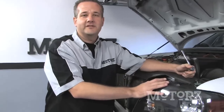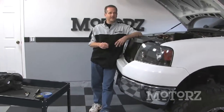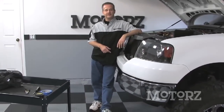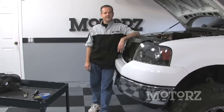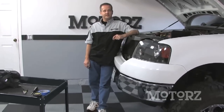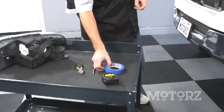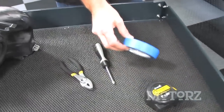It's really that easy. Now let's take this truck someplace dark so we can compare the Hella bulb with the OEM one. Any time you replace a headlamp bulb or the lens, you should check your headlights to make sure they're still aligned properly. It's actually really easy to do - I'm going to show you the quickest and easiest way. All you need is a tape measure and some masking tape - I recommend the blue stuff because it's a lot easier to see.